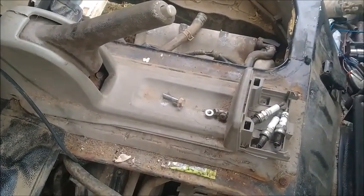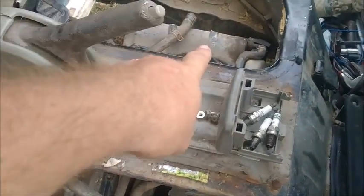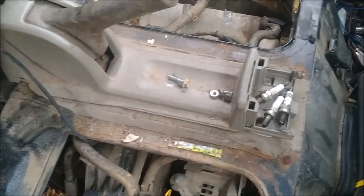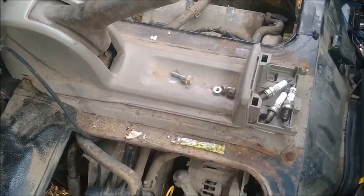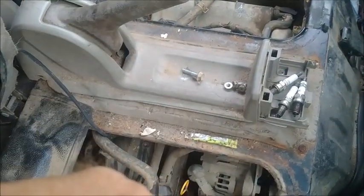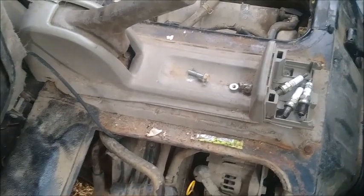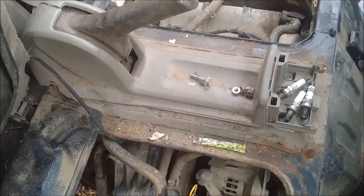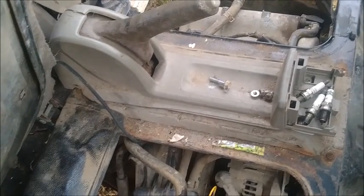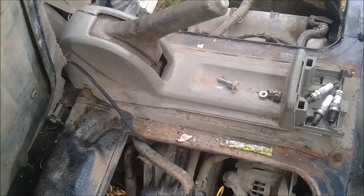Here's the order of progression: we're going to wait until he has another valve cover in case we destroy that one taking it off. Then we're going to look inside and see how things are going. We have looked at the timing chain — it hasn't jumped, all the marks are still aligned. But if that camshaft is broken, it could make it act the same way it's acting: intermittent firing, sometimes firing, sometimes not, and one cylinder will be dead. So it could quite possibly be the camshaft. If it is the camshaft, then it's complete rebuild time.